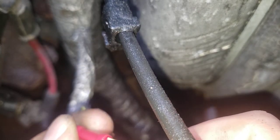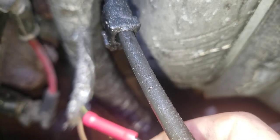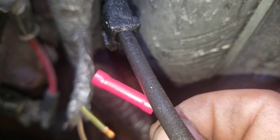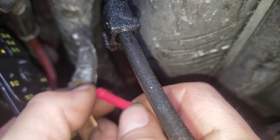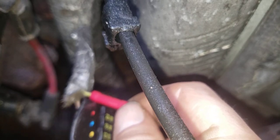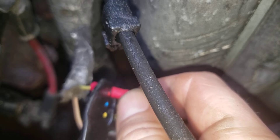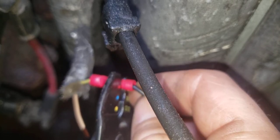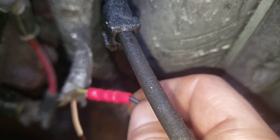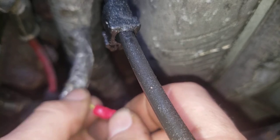Here, let me show you that again. Sometimes you have to twist the wire. I like to twist these, make sure it's in all the way. Stick the other one in. Grab it in the middle on the little red dot. This is where these wire strippers are great, for the crimping. Then I give a squeeze up here and another squeeze down here. And then check it. Pull on them. This one feels like it didn't quite tighten in there, so squeeze it some more.